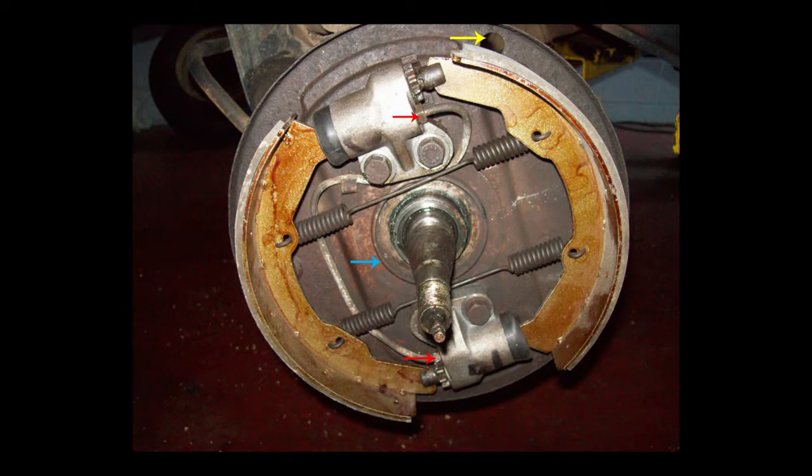This photo shows the left front brake. You can see by the little red arrows the line that connects the two wheel cylinders — that can be very difficult to remove and it's even hard to get to with a tubing wrench, so you have to be really careful and not round them off. Notice that the brake springs go behind the shoes in this photo. The wheel cylinders on the left front are a different part number than those on the right. When you remove the four bolts that hold the wheel cylinders, the entire backing plate will come off the spindle. To be sure you have the backing plate on the right side, you'll find a grease retaining ring — at the bottom of that ring there is a little vent hole that allows the grease to drain out. Make sure that little grease drain hole is at the bottom; if it is, then it's correct.